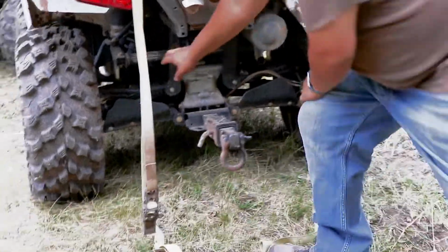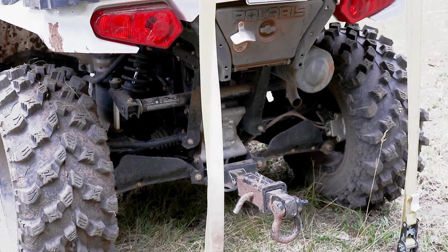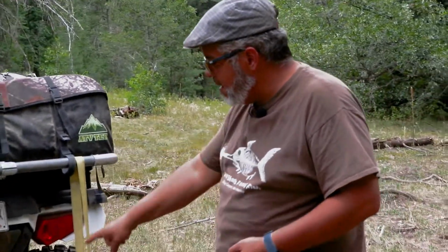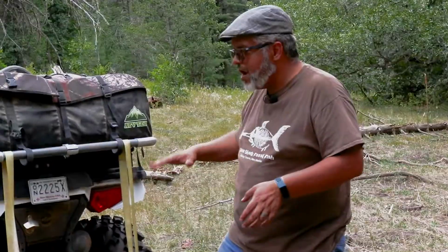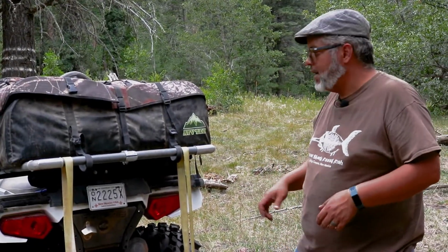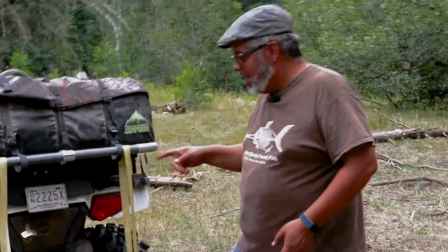Right here is your sway bar. You have adjustable shocks in the back. They're not as slick as the higher end machines where you have a dial. You actually have to use a big U wrench that looks like an old oil filter wrench. It's a little bit more cumbersome, but the basic settings are really nice, because as we have it sitting now, it's sitting kind of low, but the suspension is nice and soft, so as you're riding, you're not jarring. If you have a secondary person, you want to stiffen it up. I have a video, I'll see if I can put it in, where I have a 6'7" gentleman riding on the back of mine. I had to stiffen up the suspension, but it ran just fine. No problems. Enough power, enough suspension.